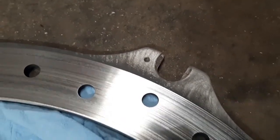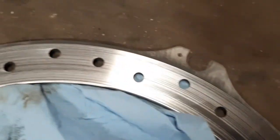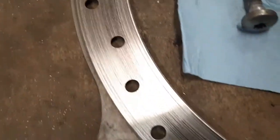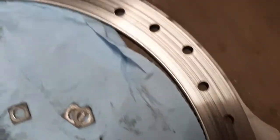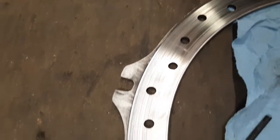When you've got them off, see that little dot — that needs to face out, so make sure you get the rotor on in the right direction. I'm gonna clean it up and rough it up. I don't really see anything too bad with it. I'll throw all the little parts in the tumbler to clean them up and then reassemble it.